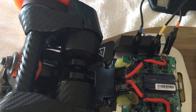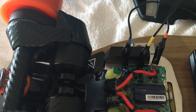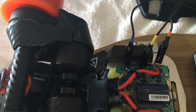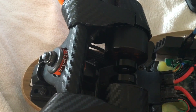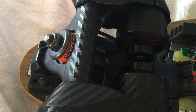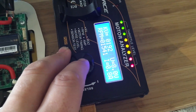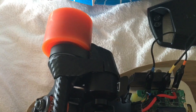The motors are a 50-55 outrunner with a 25 by 41 stator inside. To fit that much copper in there, they've actually put a lot of engineering into the motors. This is drawing 0.8 amps at low load, which would reduce if it wasn't connected to the belt.